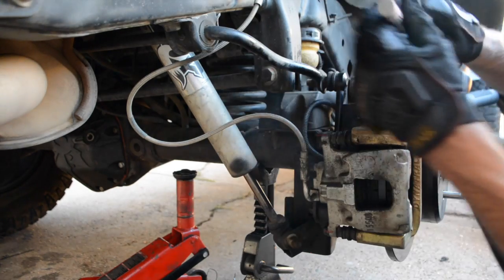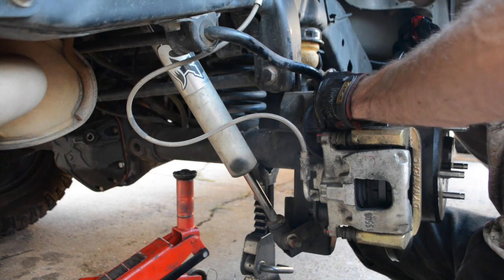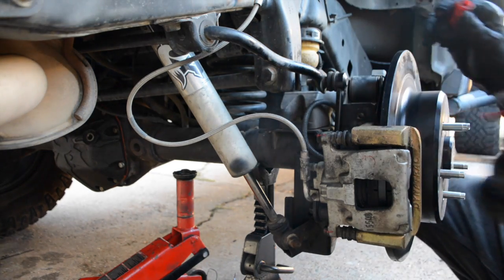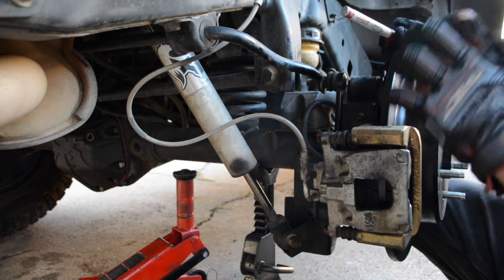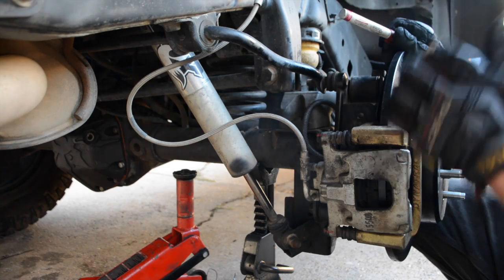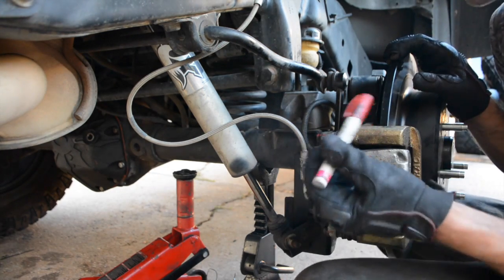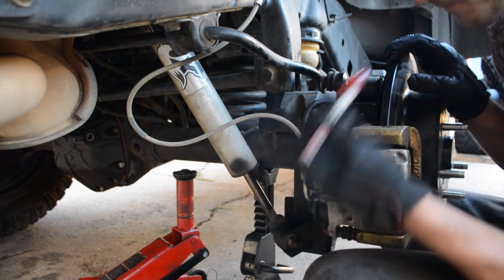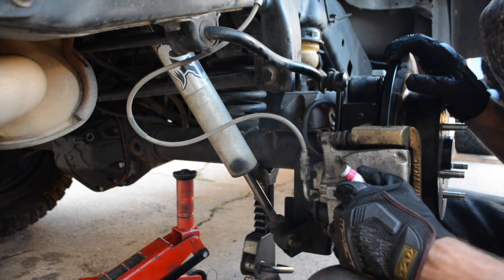So when you're done, you go ahead and you find the bolts, you put a nice line on the bolt, and then on to the nut, and then to whatever the piece of metal is. That way in the future, make it a good habit to kind of check those things. If you see something's rotating, that means it's coming loose and it's not good. So this is easy knowledge to do, easy to do yourself, and it's good knowledge to know. If you ever go off-roading and you break a shaft and you have a spare, you can swap it out right on the trail. It takes 20 minutes, as you just saw.